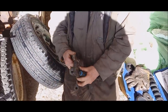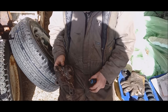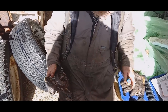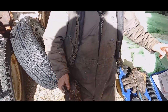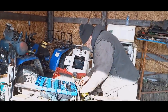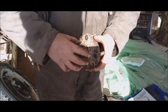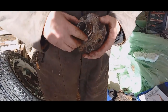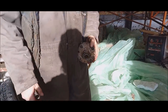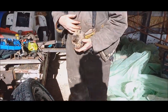Yippers. I like it, that's going to spin so much better. See, there's two pieces to this bearing, eh? So that's good. Now, we have to go take that race off there in the basement. I don't think I'm going to be able to get that off out here without heating it up. Heat up the torch. Now we'll use a hammer to get it off. And if that doesn't work, then what I'll do is just slice it. Okay, well, let's go in.